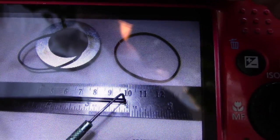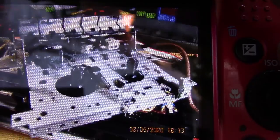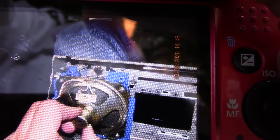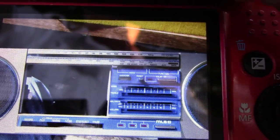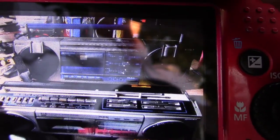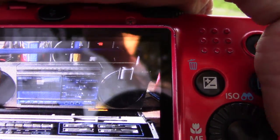And here I'm measuring them — the old ones — so I get an idea as to what and how to put them. I did put all new belts. That's how the speaker comes out. The speaker is connected. I didn't take it all the way out, just took that picture — nice to know what that looks like. And the inside, of course. Now both of these have bass and treble, but the blue one has Dolby, whereas the other one does not have Dolby.